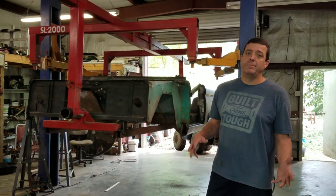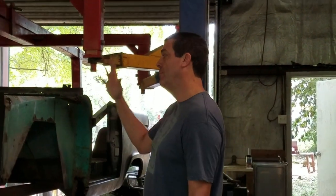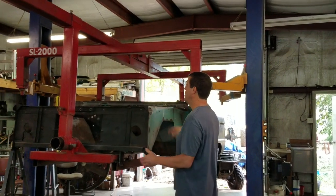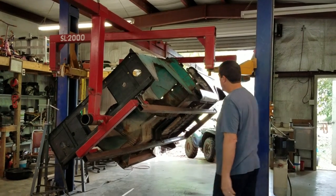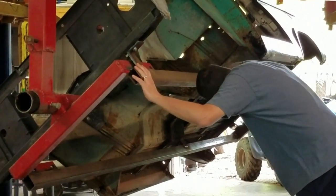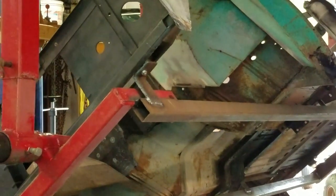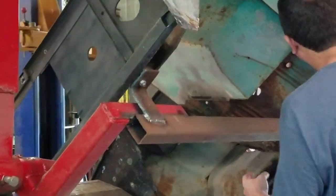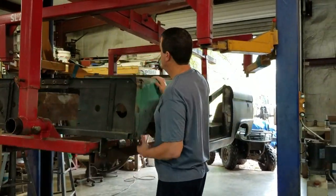This is something I wanted to do, and I didn't have the wife here to video, and I just wanted to do it. So anyways, I did this last week. I mounted my Bronco to a Mustang Rotisserie on some 2x3 tube steel. I got it all mounted to all the body mounts so it doesn't flex, everything stays where it's supposed to. So now when I want to do some welding on it, this makes rust repair much easier.